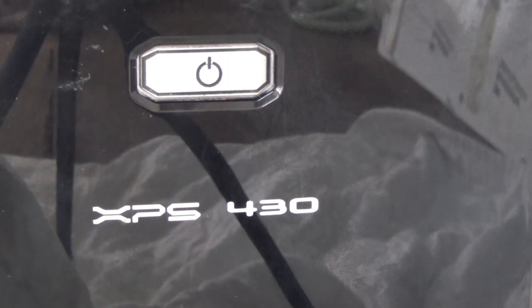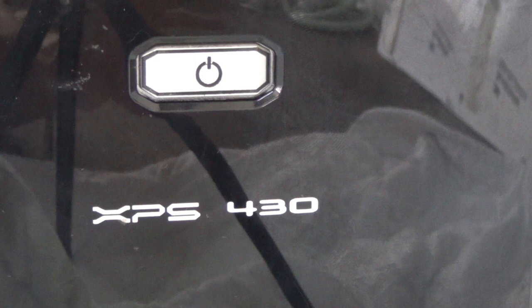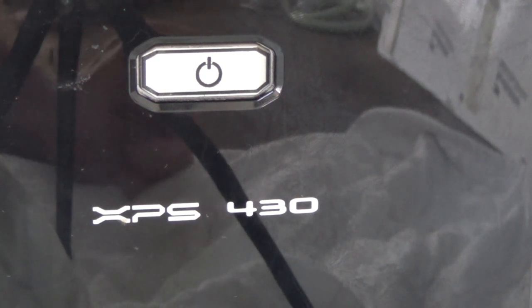If I turn it on, you can just see that slight amber flash. If I did that ten times, once or twice it would start properly. The fault is showing — it's just got that occasional amber blink. Now, if it was a slightly different type of fault, the blink would be much more solid — on, off, on, off. But because this is a power supply fault, it's just a quick blink.